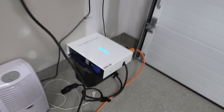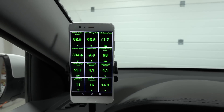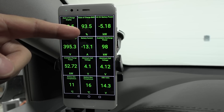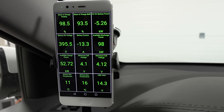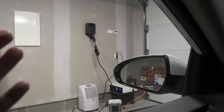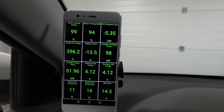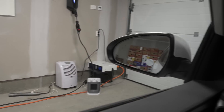There's a transformer in there — this is heavy stuff, I think it weighs around 15 to 20 kilograms. It now blinks, which means it's charging. Look — now we're cooking! Now we get 5.2 kilowatts into the battery instead of the previous 3 kW. We get 25 amp instead of 16 amp, so this is way better. It's a pretty good compromise since I don't want to have 32 amp wired stuff with fuses, because then I'd need 22 kW and that's not common. In the EC app you can see it's pulling 6 kW from the plug and we get 5.6 kW into the battery — so there are some losses in the onboard charger and in the box itself. It pulls 15 amp from two phases and the last one is not loaded.